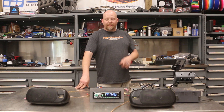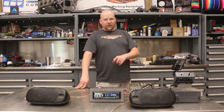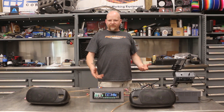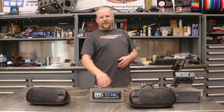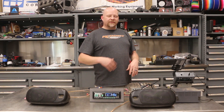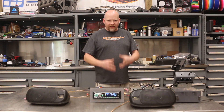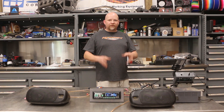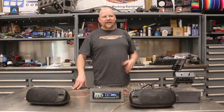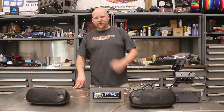Like our four-volt Alpine that we have here — I'm going to show you that in a minute. Some manufacturers have built-in amps on their head units that don't distort, so you really have to check every single head unit every single time when you're doing an install, because you never know how that head unit is actually going to perform.